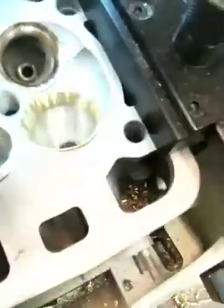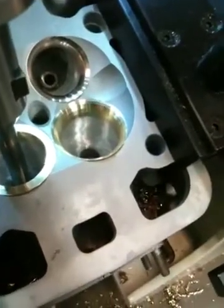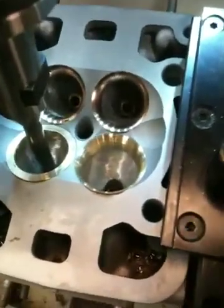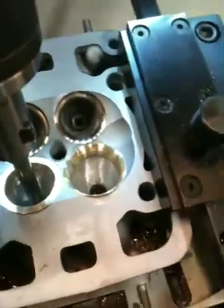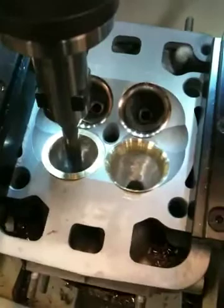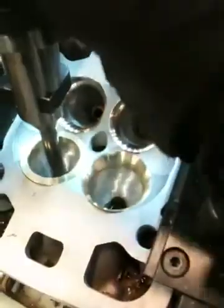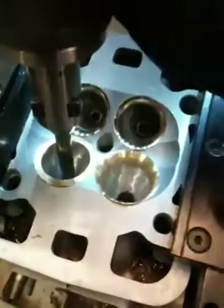You can see all the angles are cut on it now. On an intake we don't want to use a radius. I have a special cutter that I use for cutting the intake seats with various different angles on it — angles I found through research and flow bench work — which works really good for low-lift airflow.